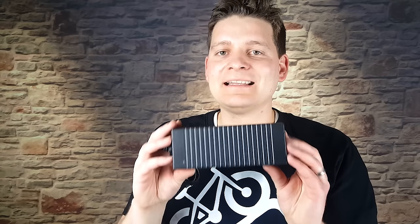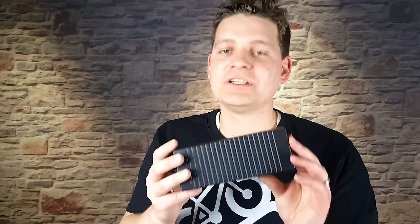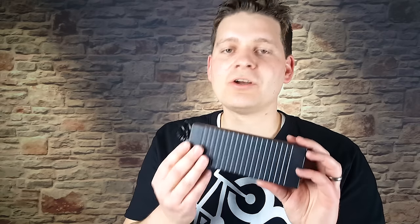Now, if you know the battery is balanced and everything's working well, I would recommend that when it's charged, unplug it. What you don't want to do is leave it plugged in all the time, every day of the week. A battery loses a little bit of voltage at all times — there's a very slow but sure drain, no matter what. So if the battery drains slightly, the charger is going to charge it right back up, meaning you're getting charge cycles in a continual mode. In essence, you're wearing out your battery, although very slowly, if you leave it plugged in 24-7. So once it's charged, go ahead and unplug it.